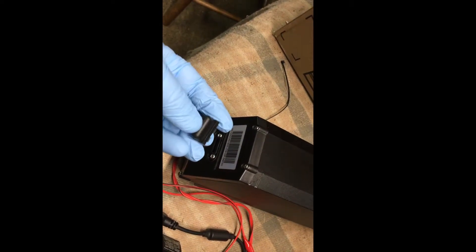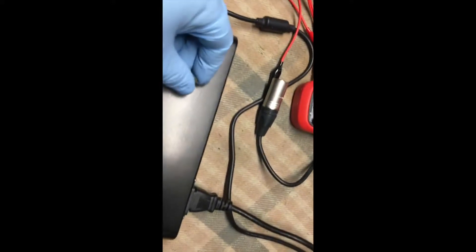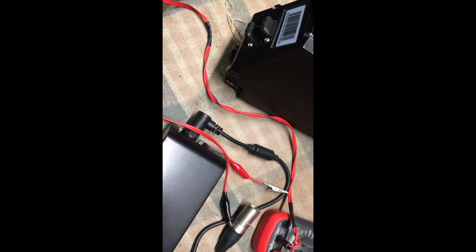Wow, that was hard. Now I hope you understand why I had so much trouble getting these out. Let me check this with continuity — putting the camera down for a second. It's good. So I will now put this one in the bottom, not in the top. Should put dielectric grease in there, but I'm not going to. Okay, now it's in the bottom. They are reversed — let me go put this in the bike.